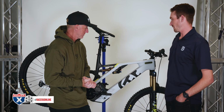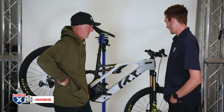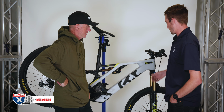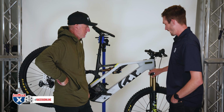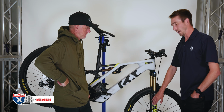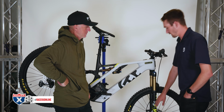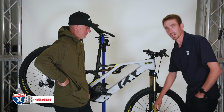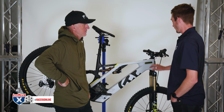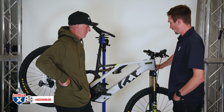Yeah, for sure. Mountain bike suspension is just as important as setting up sag and that sort of thing on a dirt bike. So first things first, on the fork, Fox and RockShox are really helpful with a rider weight to your recommended baseline setting for an air pressure in the fork tube here. It's written at the bottom. So we'll go off your weight, get a good baseline in there, and then put the correct pressure in on the left-hand side of the fork.